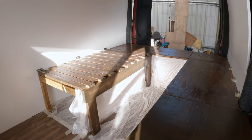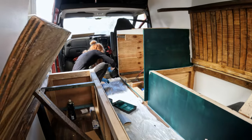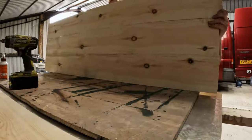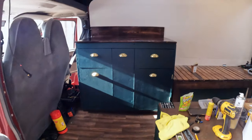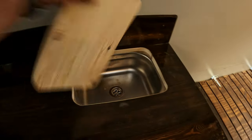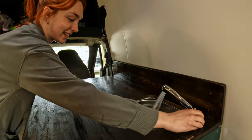With that almost done we moved on to the kitchen unit. We used the same 24mm plywood as we did for the bench tops and for the drawers we were given leftover chipboard. We painted the bench and kitchen drawers to match and built our own DIY countertop from wooden planks, stained with dark oak stain and sealed with varnish. Once the drawers were in and the handles were fixed the kitchen unit was nearly complete. For the sink we undermounted it and added a lid to maximise worktop space, and for plumbing we kept it simple: two 25-litre bottles — one for fresh water and one for grey water — plus a 12-volt water tap.